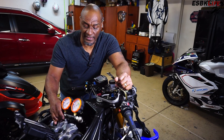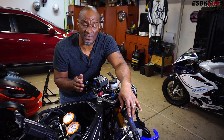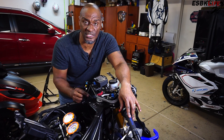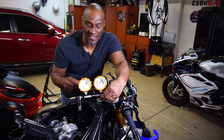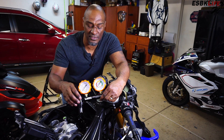Alright guys, so we're over here at the bike and I have my Lang gauges all ready to go, with my line threaded into cylinder number one. Remember, we have to find top dead center on the compression stroke — that means the piston within the combustion chamber is at its highest point and both intake and exhaust valves are closed. If we find top dead center that's not on the compression stroke, then either the intake or the exhaust valve — or possibly both — will be open, and once you connect these gauges this needle will automatically jump to red. Unless your engine is really really worn, that is a very good indicator that you have not found top dead center.